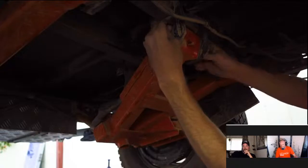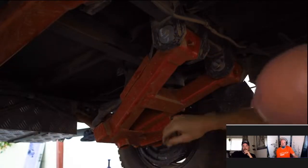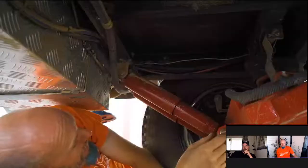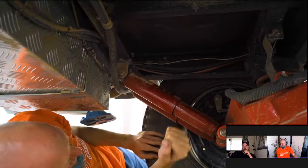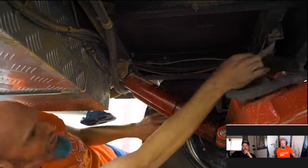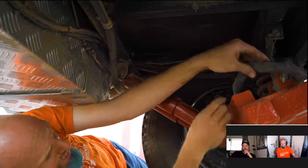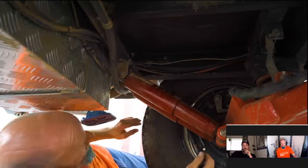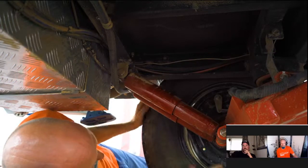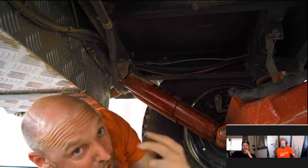While under here, make sure the bolts are all tight. Moving down the trailer: check the shocks for major dents, dings, or fluid leaks — those all look good. Check the limiting strap — in good shape. Check the brake wiring — make sure that's in good shape too. Now that I'm under here, I can also check the sidewall of the tire, though it's better when jacked up so you can spin and feel it.